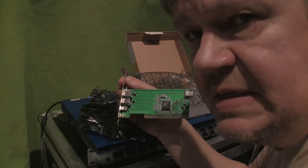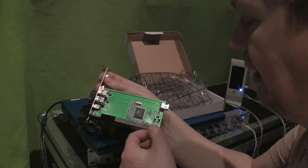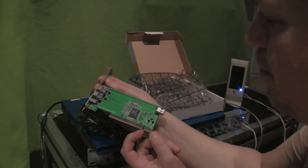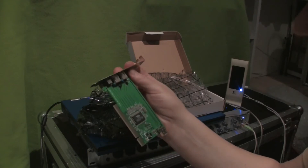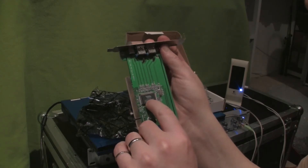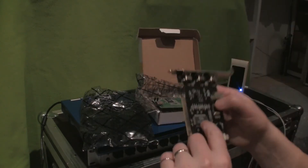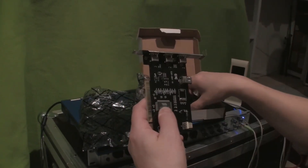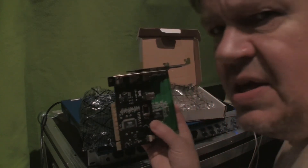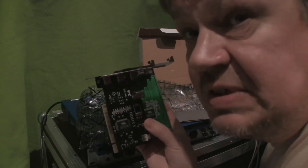PCI Express is probably a source of all kinds of trouble. You can tell the difference between a PCI and a PCI Express card just by looking at the connector that plugs into the motherboard — this is a long one, so it's a PCI card. PCI Express will have only a small stub. The chip that this card has is a VIA VT6306. Here's another one — also a VIA VT6306. I think these are the ones I bought second-hand for about 10 euros. I'm 100% sure I've used one of them, but it requires that your desktop computer has a PCI bus.